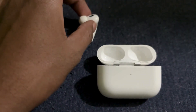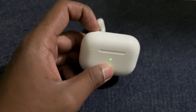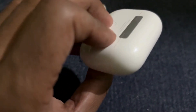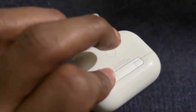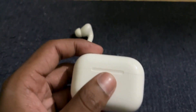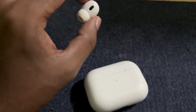After that, put this one away and then put the first AirPod back inside the case and close the lid. After maybe 10 seconds, hold the button again. You don't need to forget any devices or anything — just hold it again. With this AirPod in the case, it will be recognized as another device. In my case, it was 'Prantoosh AirPods Pro' and this one was recognized as 'Prantoosh AirPods Pro 2'.